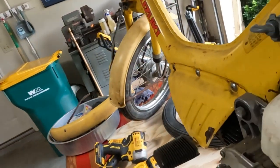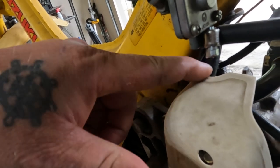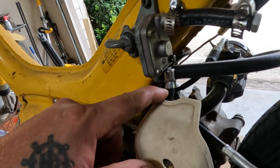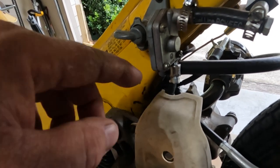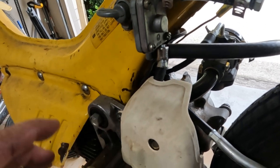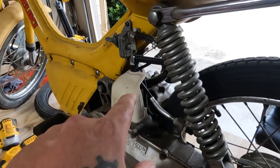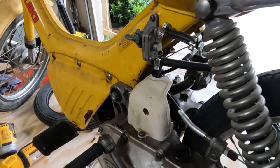So I've come up with a solution that's gonna work for right now. Here's the tube that comes down from the oil tank — it's just a fuel line. I'm gonna put a little valve on it right there, so when I shut it down and park it, I can turn that oil off. Then very little oil, whatever's trapped in here, will get down — but not the whole entire tank anymore. I'd like to get that fixed before I go get this thing inspected and get on the road. Today we're just gonna finish up the rear brakes.